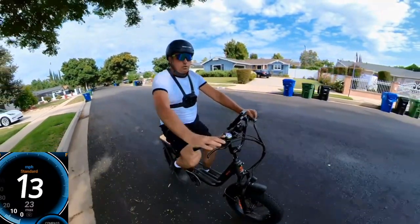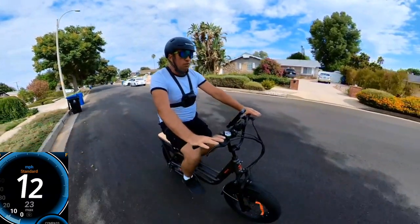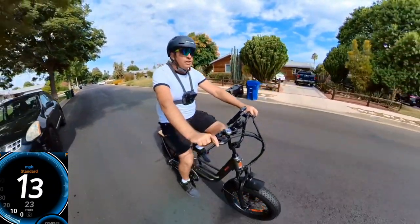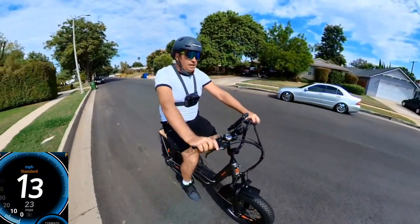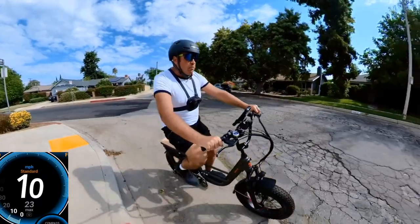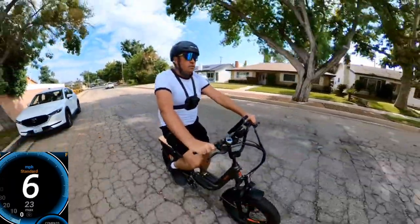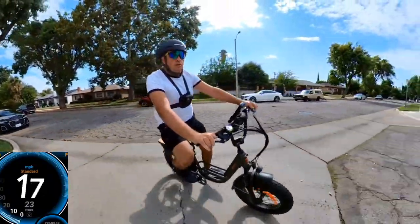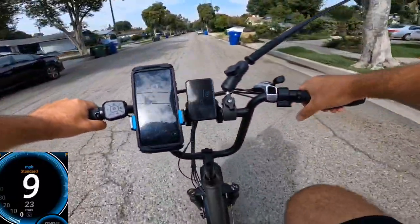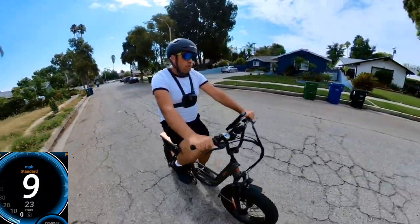The grips are very comfortable — I think I could pedal long distances on this bike easily. On pedal assist level 1 I'm going about 12 mph and I can feel the torque sensor responding. If I pedal lightly — ghost pedaling — it won't activate assist, but when I push down I can hear and feel the motor kicking in. Switching off power, I'm on gear 4 going about 9 mph pedaling like a regular bicycle.